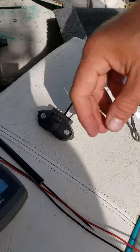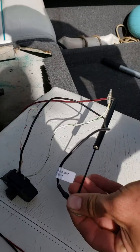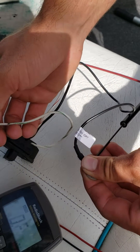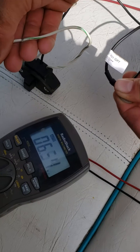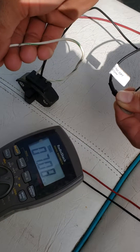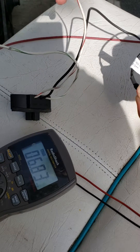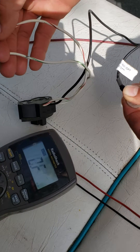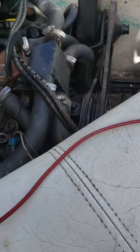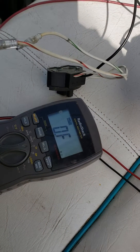The way we could diagnose this sensor was by taking an ohmmeter and checking the resistance on it. So right here I have ground, and we're going to hook one wire up. What's that measuring? About six, seven megs — that seems to be changing around over time. So that was the green wire relative to the black. Now we're checking the red wire, and there's zero megs on that.